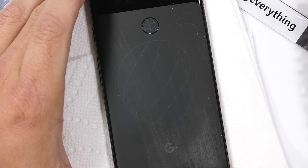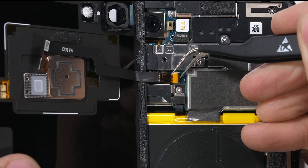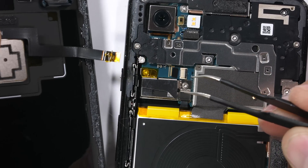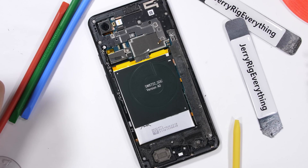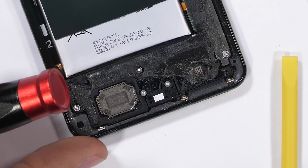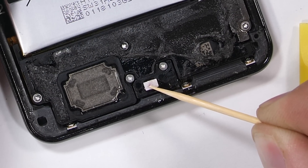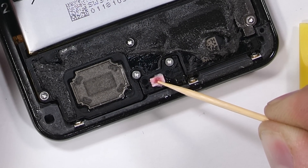Back to the teardown — let's see why it's a bad idea to get your phone wet. Unlike the normal sized Pixel 3, this fingerprint scanner is clipped in with a latch style connector, which lifts up and then lets the fingerprint scanner come loose from the motherboard. Now the Pixel 3 is IP68 water resistant, not waterproof, meaning that water can still get inside the phone if it's deep enough, or if there's added pressure from a faucet or steam from hot water. Google can tell if your phone has been wet by this little white sticker near the charging port — it turns pink when it comes in contact with liquid. So putting your phone in the sink is just not worth the risk.